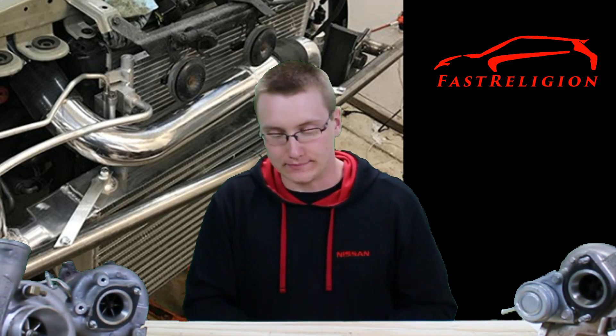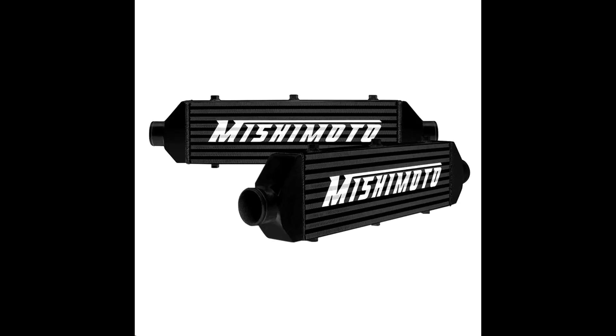When we get into front-mount intercoolers, you can actually have too big of a front-mount intercooler. There's a reason companies like Mishimoto and even Garrett make different size intercoolers — it's not a one-size-fits-all deal. You need to look at your turbocharger, your total flow rate, the amount of plumbing you're running, your boost pressure, and your horsepower range. For example, the Mishimoto Z-Line intercooler is rated to 20 psi where it's effective. When you're at 20 psi, regardless of turbo size, you're at the top of its effective cooling range — meaning it can't flow enough CFM through it to cool the air.